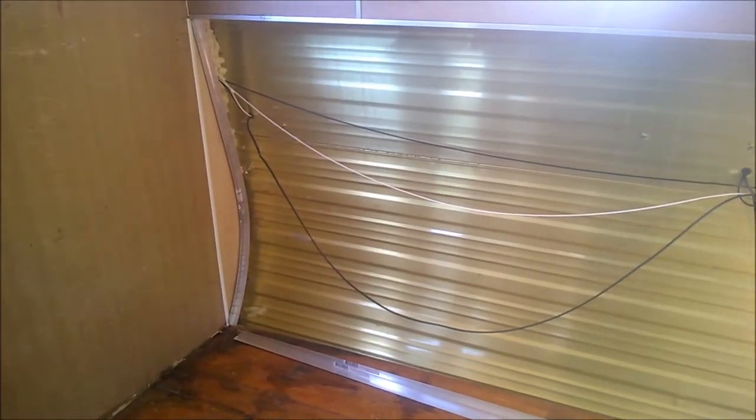Now, aside from the rear panel being damaged, there was also damage to these side panels here. This one here was actually an extension of that, and what I did was I just sliced it down, removed the rot, and put the new panel in there, and then gave it a bit of that filler foam to give it a little bit more structure behind.